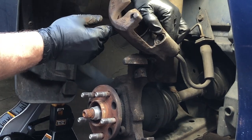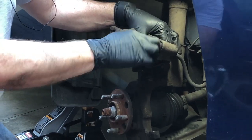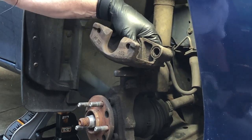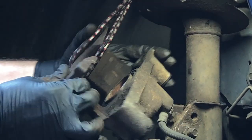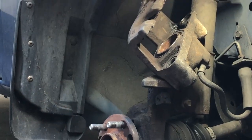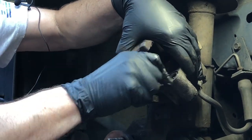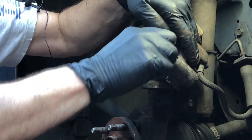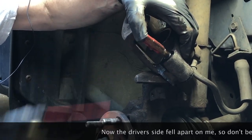The last thing we've got are these bushings — these rubber bushings. The way we're going to work with those is we're going to get a flathead tool and work in there to break the corrosion seal off where the rubber touches the cast iron of the caliper. I'm also going to put a little bungee so the caliper stays in place while we work, so we don't drop it or put any pressure on the hose. All you're going to need is a small flathead screwdriver — we're going to work this away from the bore. You can stick silicone spray in here; I'm just using a little bit of PB Blaster. We're going to grease up the interface between this rubber and this bore.